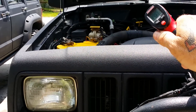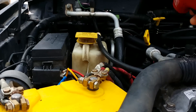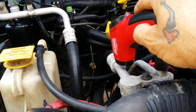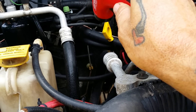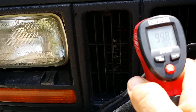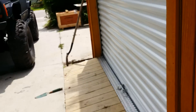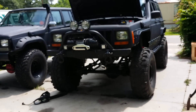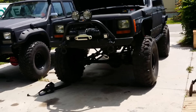When your refrigerant goes through your evaporator core, it sprays in there as a cold liquid and when it starts coming back through on the high pressure side - the high pressure side is right here - it goes down through a spray nozzle inside your evaporator core inside the fins. It's cold going through there, comes back, and by the time it gets back through here it's hot again. I'm just saying if you've got your AC running out there on the trail, that condenser in front of your radiator is going to get about 130 degrees.